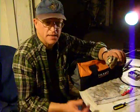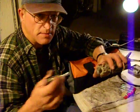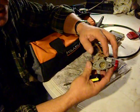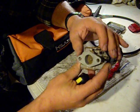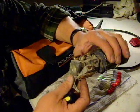Now, when you get to this, they all have basically the same operation. There's a little valve that's hooked up to your cable that opens and closes the throttle plate. They all have a set screw of some design to keep the idle down.